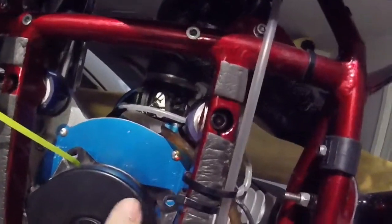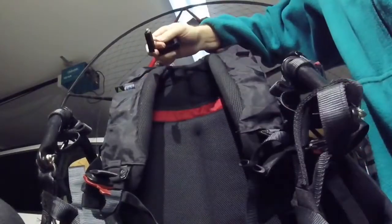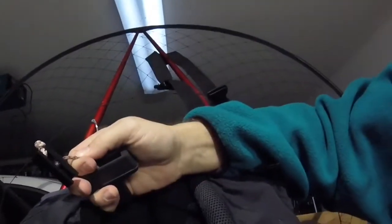Now the bolts are out. You can see this cord just goes up out of here, through the pulley, and then up to the top. So we're just going to take this handle off — see that part just slides out — and then I'll take that out and cut it off. Then I can thread it back through and I'll be ready to put the new one in.